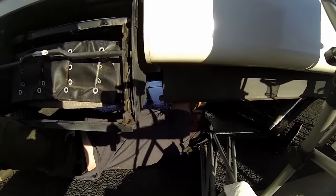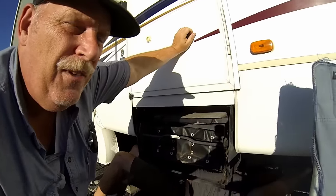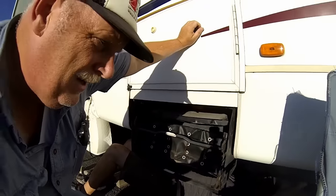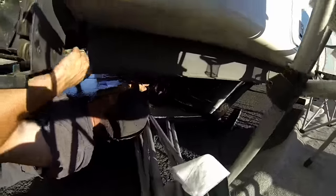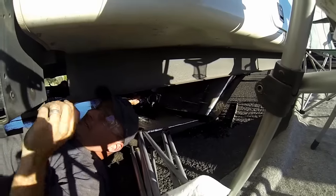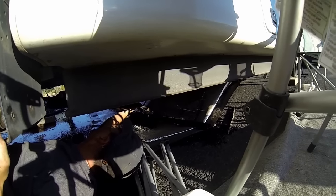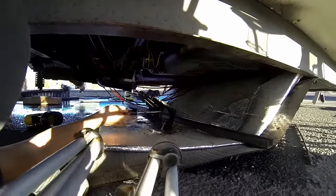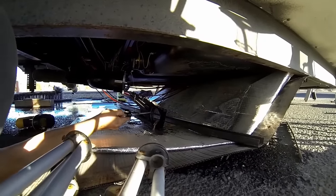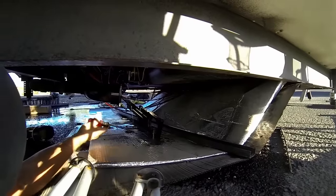We're over here on the other side of the rig, and Todd's under there loosening the black tank. Lesson learned about how it's plumbed — but physically, both of them would have had to be detached just to be able to maneuver the pipe. That's stuck, and that's why your black's not closing — see that? So if we clean that out, you can actually go over and test your black tank. Looks like it's wedged down into the gasket — we may not have to replace it. We've got debris in the valve.